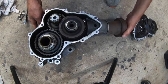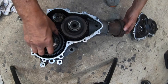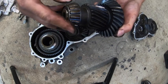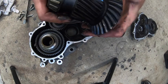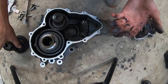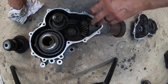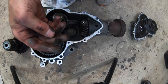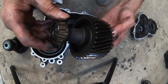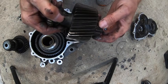Alright, here we have the gear set. That sits in there. Bearing set here. Let's pop this bad boy out first. Roller bearings. Gears actually don't look too too bad. Roller bearing set here. Lots of fine metal shavings all over it though. What's this? Oh yeah — a nice chunk of a gear. Let's see where that piece comes from. Roller bearings, another gear set here. Roller bearings. Not too too bad.